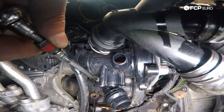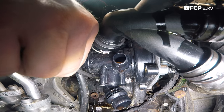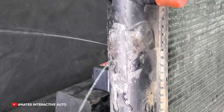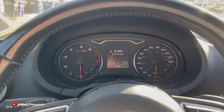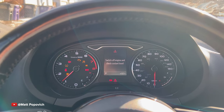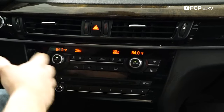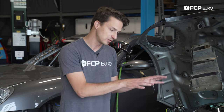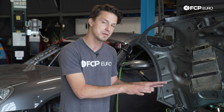There are a couple other reasons that could cause an overheat situation: whether it's your water pump not cycling water through the engine quick enough, a thermostat stuck closed, or possibly a pinhole in the radiator, or low coolant in the system. A couple easy ways to identify those — first, just check your coolant gauge. Another really surefire way is by turning your heat on and making sure air blows hot. If the air does not blow hot, that indicates there's not enough coolant in the engine, and the coolant level may be below the temperature sensor so your gauge may not be picking that up.